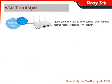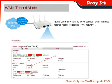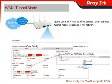Another situation would be the tunnel mode. This is for when the local ISP has no IPv6 service — users can use tunnel mode to access the IPv6 network with the help of an IPv4-to-IPv6 tunnel service provider. From the web user interface, you can see we still have dual stack and a global IPv6 address, but we changed the mode from PPP to TSPC. In fact, there are two connection types for tunnel mode: TSPC and AICCU, both used to connect to the IPv4-to-IPv6 tunnel service provider.